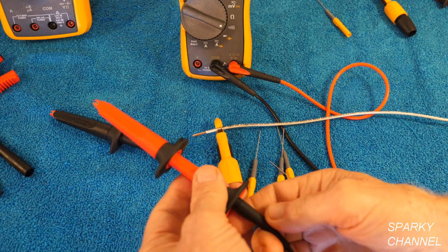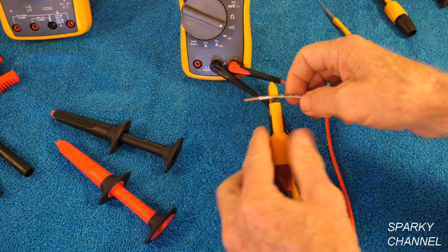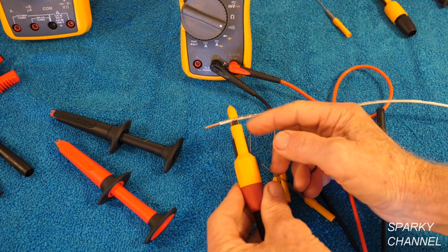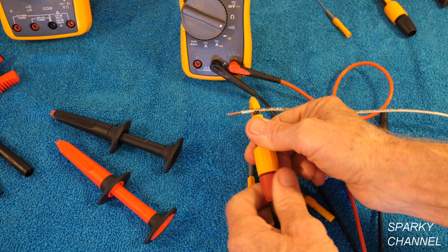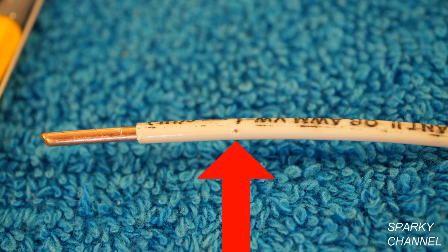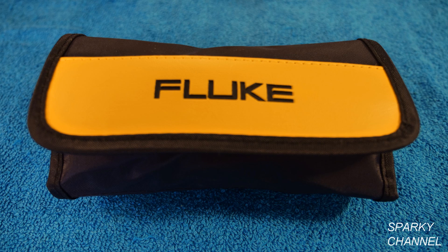So there's your set — that's a really nice automotive set and you can do all kinds of repairs and testing with it. The back probe pin hole is supposed to be so small that they say it's self-healing, but I would put some liquid electrical tape on that little hole just to be sure. The set comes with a pouch that rolls up for easy storage.